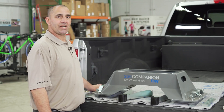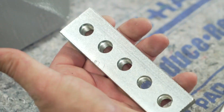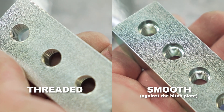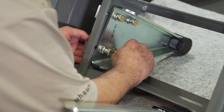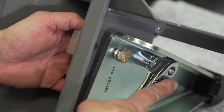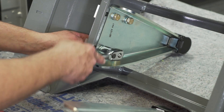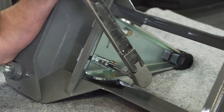To begin this installation, we're going to mount the pivot arms to the base using the threaded block and provided hardware. Make sure that the smooth, bored holes of the threaded block are against the hitch plate. Depending on the kingpin location, the installation of your pivot arms will vary. Your pivot arms can be mounted in three different locations: low, medium, or high. We're mounting ours in the medium section. You can tighten this using a 19mm socket or 3/4". Now I'm going to torque the bolts to the manufacturer's specifications.